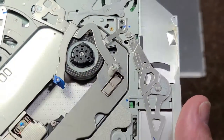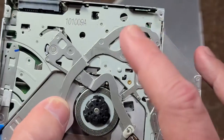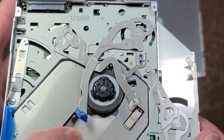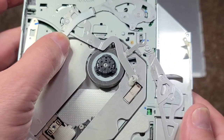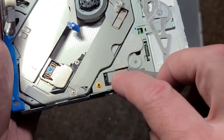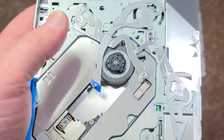The deal with all these pieces of sheet metal is, one, they have to not have burrs so they don't catch, and two, they all have to be super flat. And surprisingly enough, to make a piece like this — stamping it out and ensuring it's super flat — is not very easy. And so this is just the arm; when you put the disc in, this arm hits a lever and then starts driving this motor here, which runs the whole mechanism to pull the disc in.